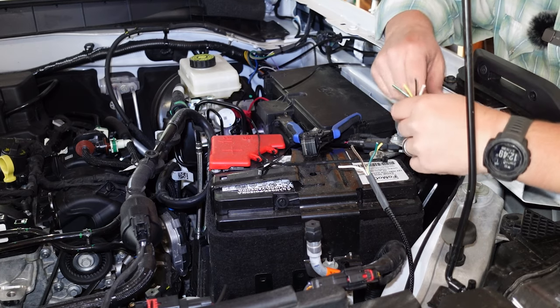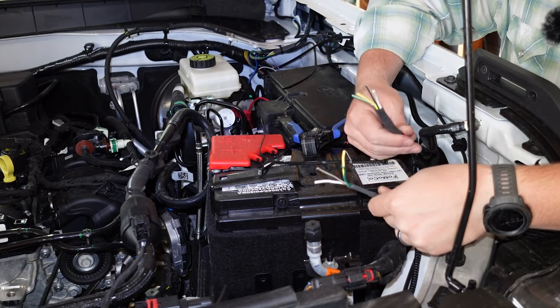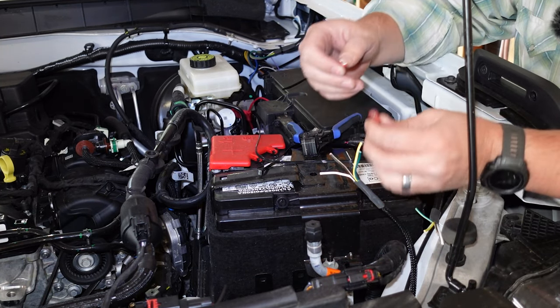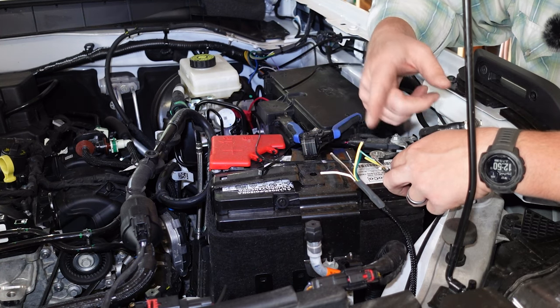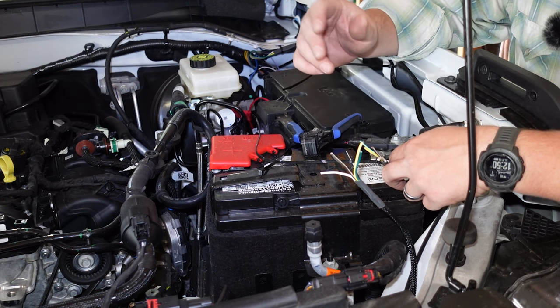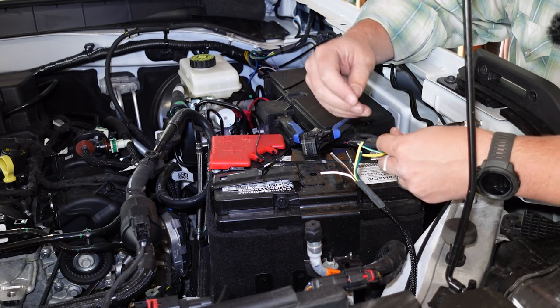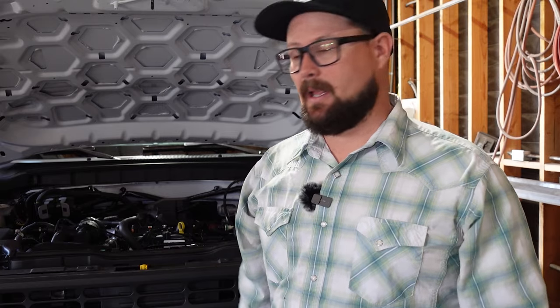So here we are. We got all of our wire ran, got it all put up out of the way. We've got both ends here and we're just going to connect our colors using these spade connectors here. We don't want to hardwire these in or make anything that's permanent in case we do change our bumpers out, or maybe in the future we decide to add one of those RV 7 pins. So this gives us a service point. We had already ran that wire in another video, so that saved us a lot of time.